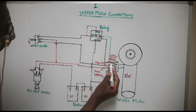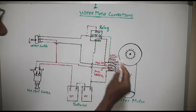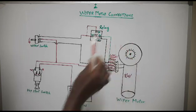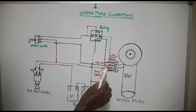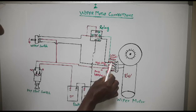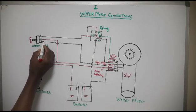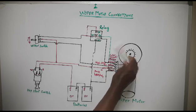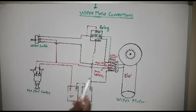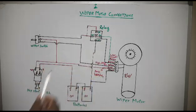The brown wire connects here and gets power from the gray wire — park brake voltage comes from here and is given to this wire. The motor continues moving until it reaches its predefined park position. When it reaches the predefined park position, the motor switches off because the voltage is cut from this wire. When we push this button up, the voltage connects to the yellow wire, which is high speed, so the motor moves quickly and the wiper moves at high speed. This is a small introduction to the wiring diagram you can use for any motor in vehicles or machines.